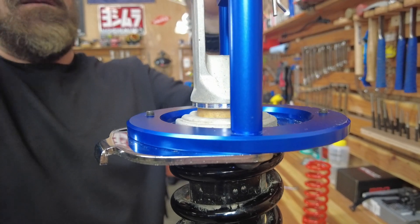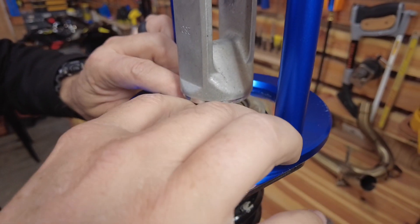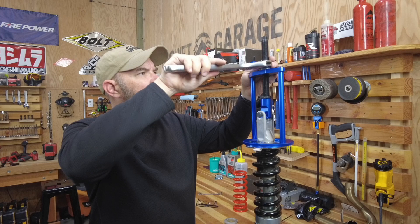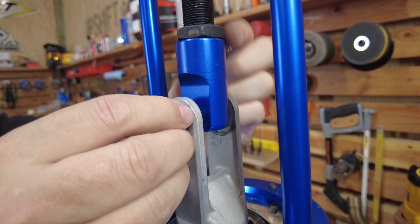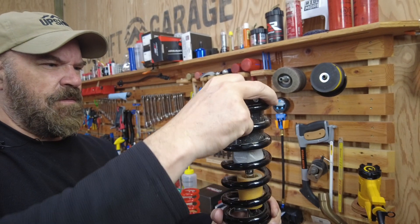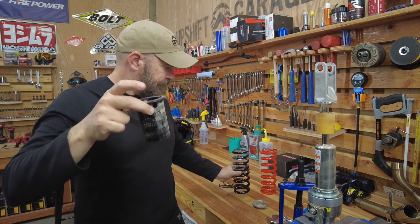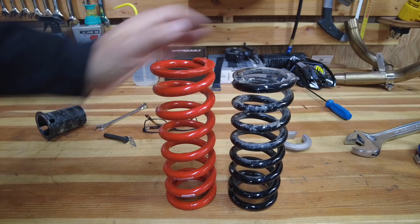It's pushing down on there already. We've cranked on it about 20 times. You can see there's this little foam thing here — we have to clear that just in order to get this collar off. Now we can loosen this and back it out, then take the old spring off and put the new one on. Pull the pin and there we go. Take the spring part, leave everything else. Of course, you'll have this little spacer — make sure all that stays with it. We'll put the new spacer on the new spring. You can see the difference: the diameter is much bigger and it's also a little longer.